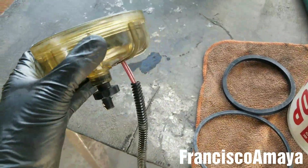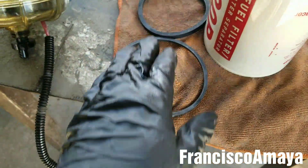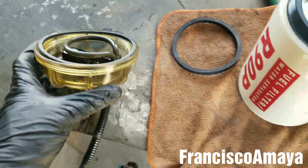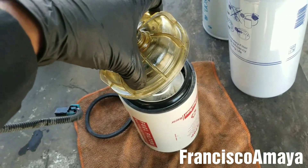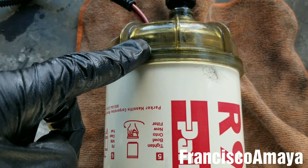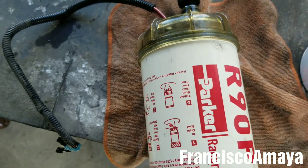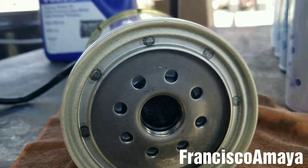Now it's time to install the cup with the fuel water separator. In this case, the fuel water separator comes with two new seals — this one is for the top and this one is for the water separator cup. This seal goes right here where we removed the old one. It's a bit tricky with one hand because the seal falls easily. The carrier cap is in place and the seal is where it's supposed to be — double-check that, it's very important. Otherwise the engine won't start, or it will start for a moment and shut down because there is air in the fuel system.